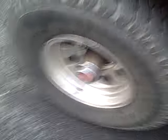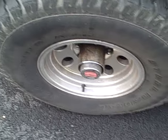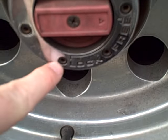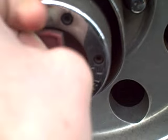Just come over to — we got this in the cab. If you have automatic locking hubs, skip this step. For all you old-school people, there are two selections on my hub here, on the center of my wheel. One says free, the other says lock. So what I want to do now is turn it so it's on lock. Then you come over to the other side and turn it to lock as well. So now we're locked — now we're in four-wheel drive.